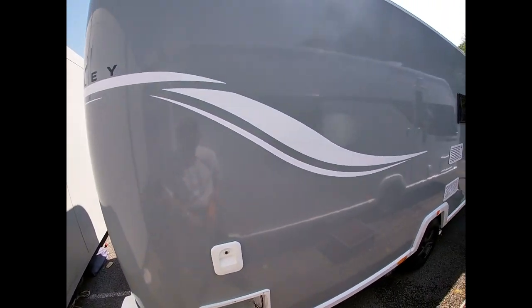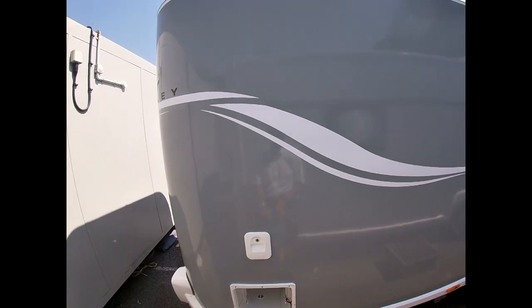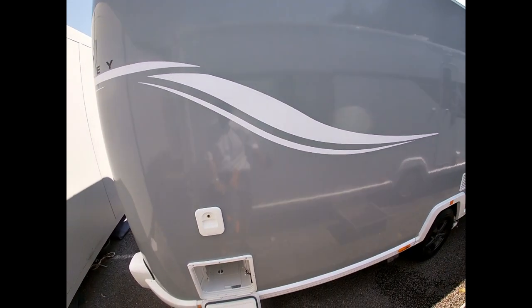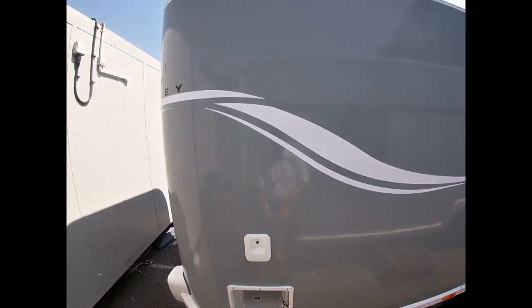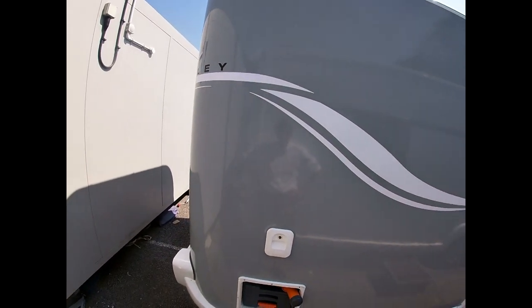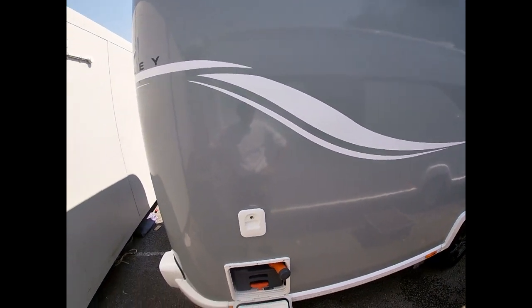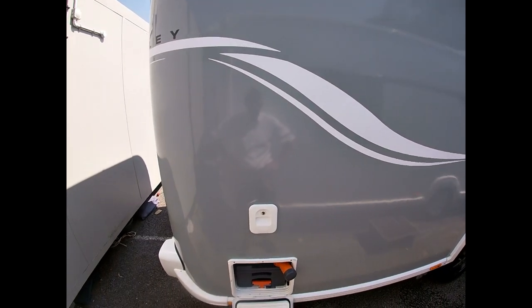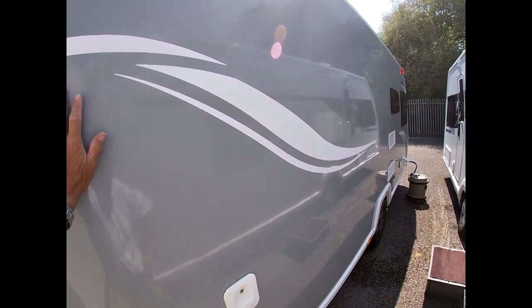We do that by the good book stating 75ml of blue chemical and adding 2 litres of water. If you add 2 litres of water, in my book, that's an awful lot of liquid wastage. So I tend to put a couple of glugs out of my container of blue into there and not add any water when I'm using it. If I'm going to finish for the weekend and I'm out in a couple of weeks' time, I just give it a little flush through to dilute the blue I've put down in the bottom. And in the winter, when I'm finished with it, I bleach it out, clean it out and leave it empty ready for next time or the following season.